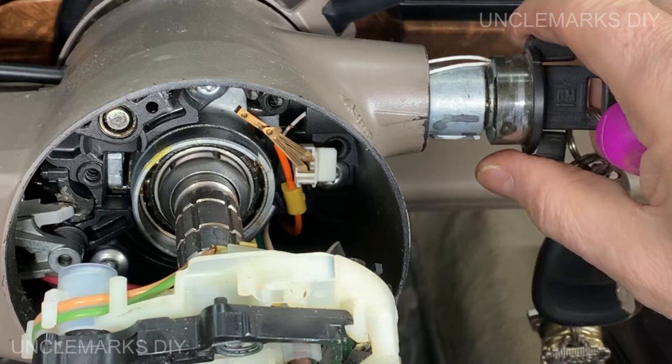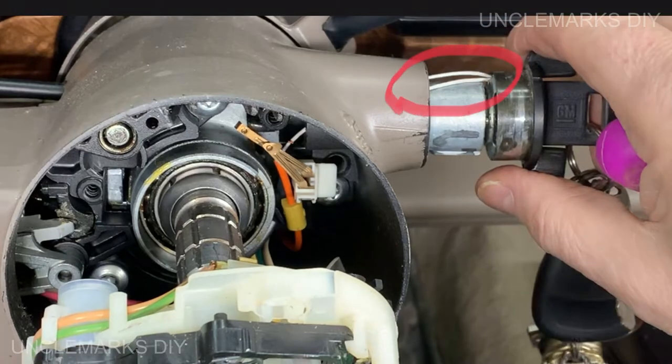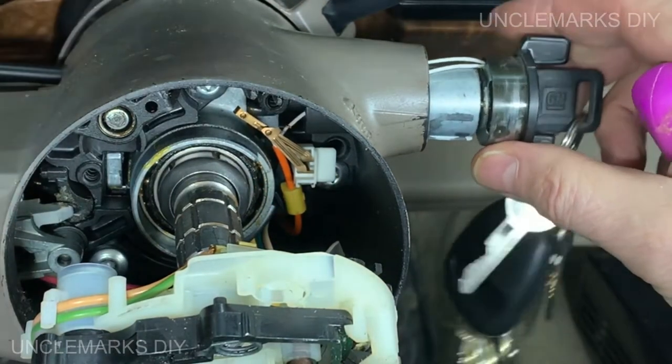Now these two white wires in the right top, yeah, right there, and this orange one are all one long wire. You don't want to wreck them because they're part of your anti-theft system. If they're broken, this car will not start. Now this, of course, we mentioned has been modified, so be careful, don't break them. I am going to cut them because I don't need them, but you're going to have to figure out how to take this out if you're replacing this whole locking mechanism yourself. This video doesn't go into that. Sorry about that. See the two wires?